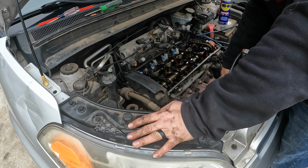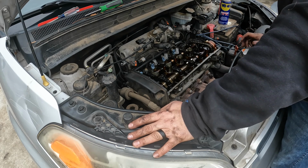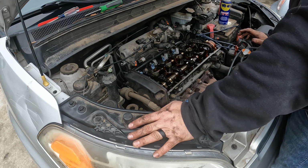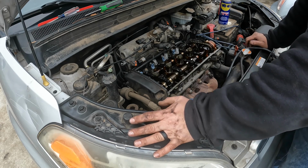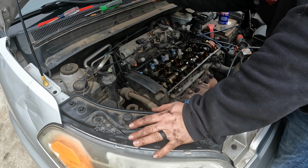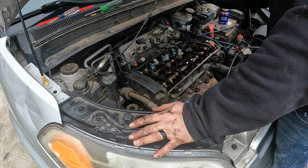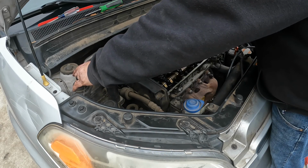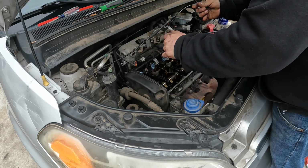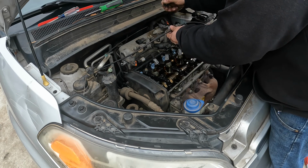the throttle cable, the cover on the exhaust manifold, and I think that's it as far as the sensors that I took off. Most of these sensors are just little squeeze tabs. You just push in, pull up. The throttle cable and the cruise control, had to think for a minute. The cruise control, they just have these little pull-up clips. You just pull them up.